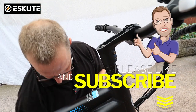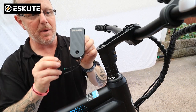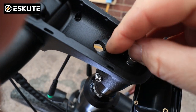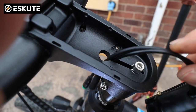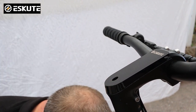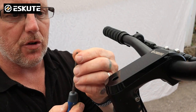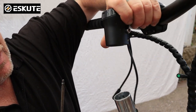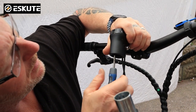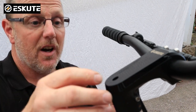Get your replacement one and you can see the difference — they're both exactly the same shape and size. The one with the two wires is going to go back in. You've got to feed one of the wires down through the hole, then take the wire and lead it into the slot in the top, then poke the other one in. Once that's in place you need to replace the screw in the bottom first, so you know it's inside and don't have to worry about it. Take your screw, put it on the end of your screwdriver, lift up the stem, slot it into the hole and do it back up. Then put the stem back on the top.